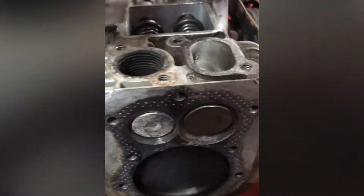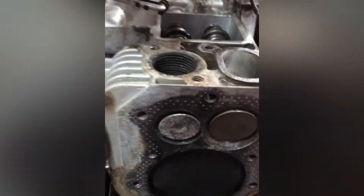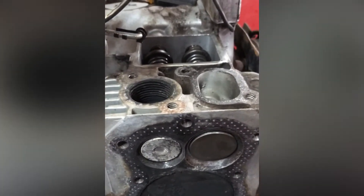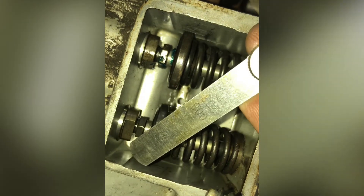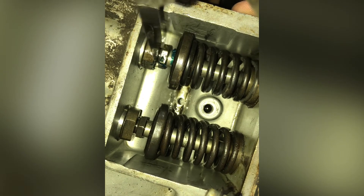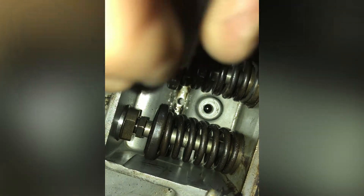What I like to do is just rotate the engine. The intake valve opens, then the exhaust valve — we all know that. The piston comes back up. The specs on these are 13 and 8 thousandths, so normally your exhaust is bigger and your intake is smaller. We're going to go in between the lifter and the valve stem and put our feeler gauge inside there. Usually when we lap valves it gets a little tight — there'll be like a little nut-looking thing in the lifter. If it's too small we'll turn it in.